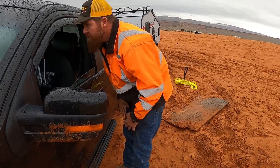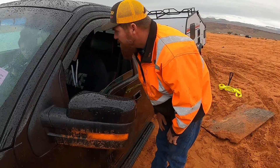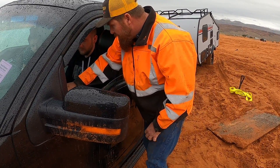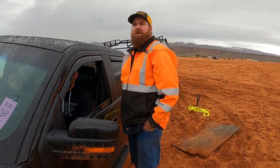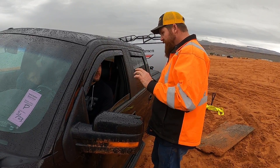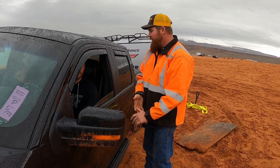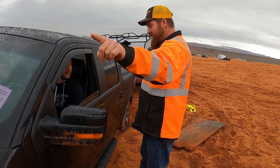What have you got for traction control and stuff? Are you in four low? Yeah, four low. Okay, so when that goes straight up, your wheels will be straight forward. I'm going to pull forward and stretch this rope out so I know where the end of it is. Then I'm going to back up and when you see me start to go, just give a little bit of gas — less than 2,000 RPM. Once we get going, back off. Make sure I'm doing most of the work and you're keeping that rope tight.